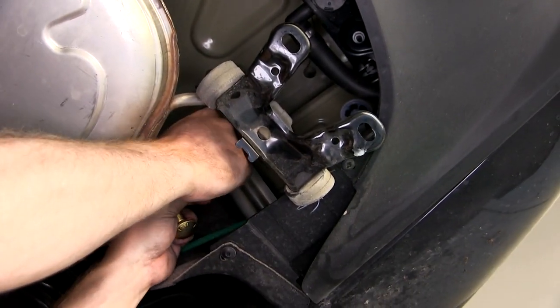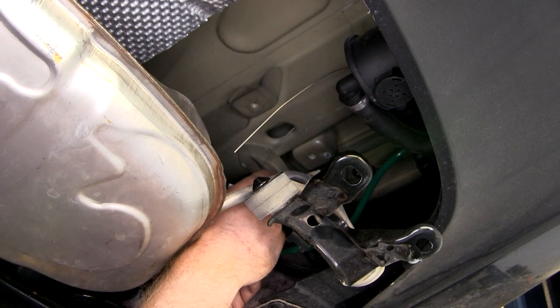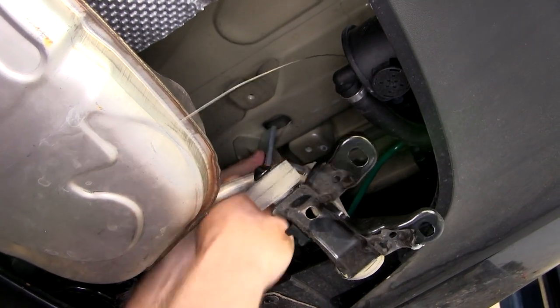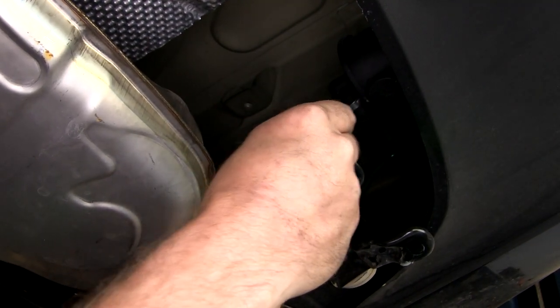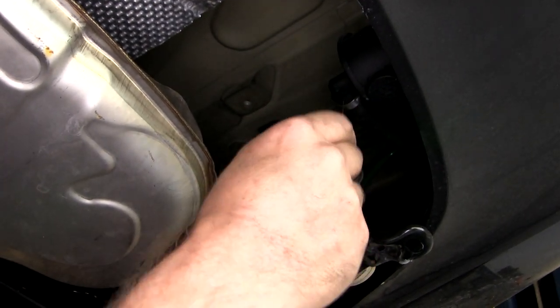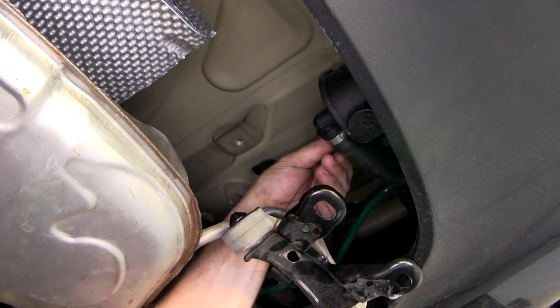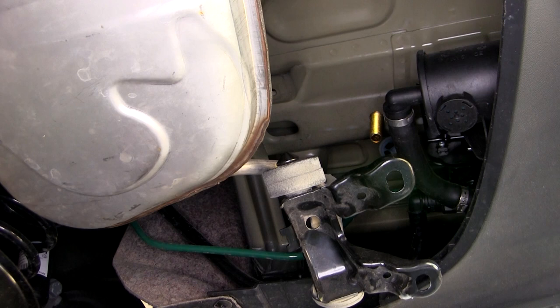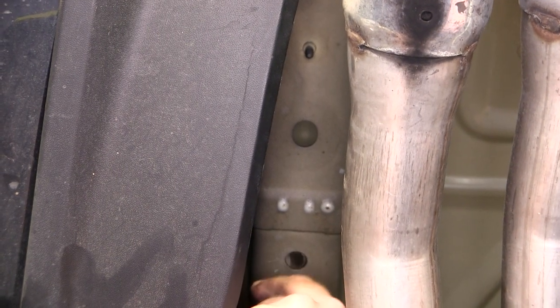You'll then feed the square hole spacer block onto the fish wire, then thread the 1/2-inch carriage bolt onto the end. You can then push the square hole spacer block into the access hole, and in this case we found that you had to put the head of the bolt in through the hole first to allow it to go in. Once everything's in the frame rail, go ahead and pull down, pulling the carriage bolt through the hole and seating it into the square hole spacer block. We'll repeat this process for both sides.